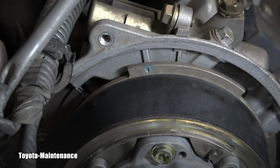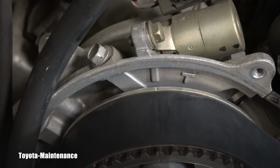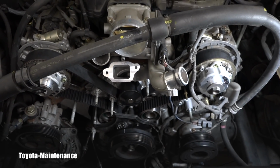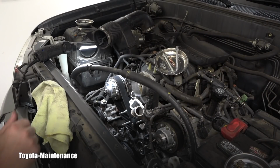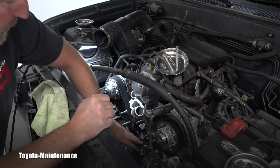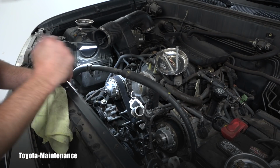Excuse me for that. So once again, I just didn't want to pause it so you can see that this is what I did, right? It's all perfect. Look at the balancer, it's on the 0. They are all rotating correctly together. This job was done correctly, and I can start putting it all together. And I always keep rechecking, right, the tension of the belt if there's not some slack or something. But all these parts have an equal tension. This is perfect. I'm happy.